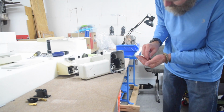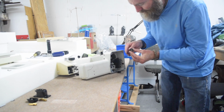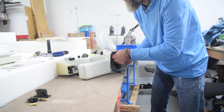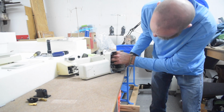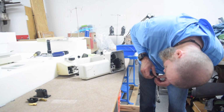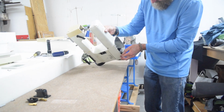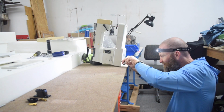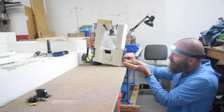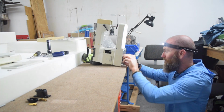So this is a little bit of what I mean about the installation as the reverse of removal, in that removing this motor just meant pulling the wiring right out of that housing. Getting it back into that housing is a little bit more problematic. And these screw receiving plastic pieces and washers tend to fall out, and only one can be held in by gravity, at least in this orientation. I suspect I'm going to spend more time trying to get this back in with the motor inside here than if I would just take it out. So that's what I'm going to do.